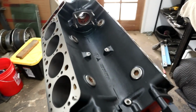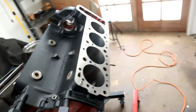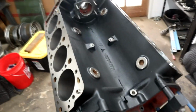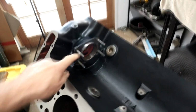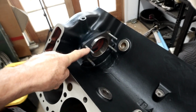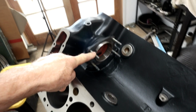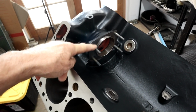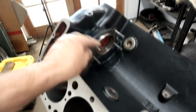So the other tip, besides not doing what I did, as in taping everything up and then blowtorching, you want to blowtorch, get it completely done, and then tape up, obviously. So one other thing, don't tape the bolts. Okay, you're thinking, well, hang on a minute, why? Because I can tell you what a royal pain in the butt taking the masking tape off the bolts is. Once there's paint on it, there's little bits of crap everywhere in the thread.